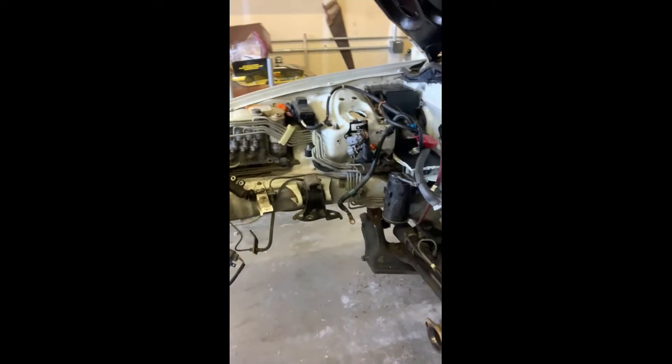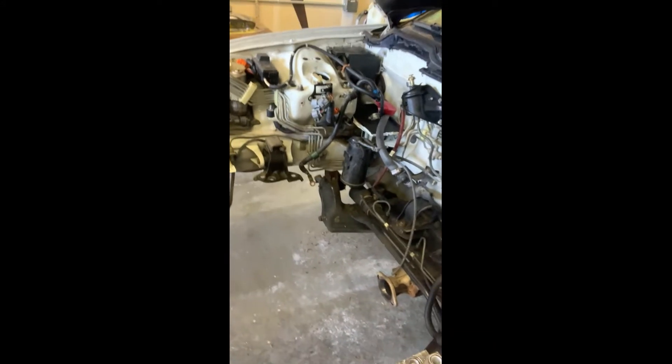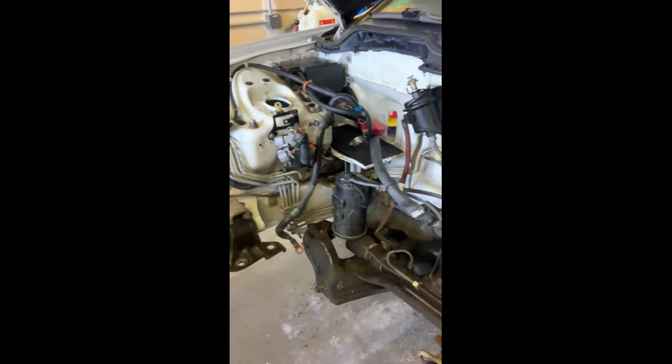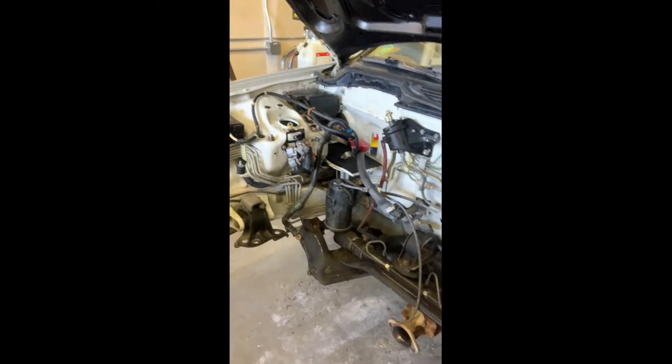These videos — one of them was moved from my Facebook onto the Lucky Dogs Facebook and some of the Honda guys saw it and gave me some advice. I was told that the whole ABS system and all the cables for the ABS brake system have to come out and I've got to switch this car back to non-ABS. That's going to work much better for what we're doing.